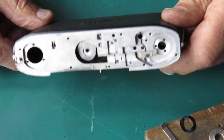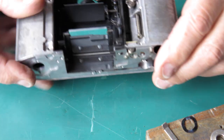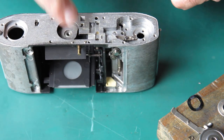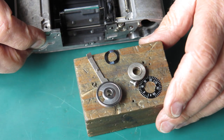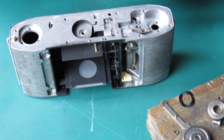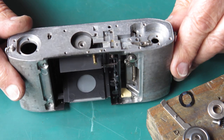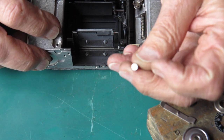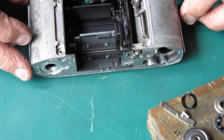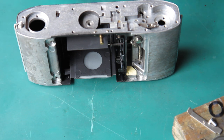As you can see I've been busy — I've been cleaning. This is all nice and clean now. The body is ready to be reassembled. I took the frame counter out — you didn't see me doing that. Basically it's all held in with a single screw from the center. Taking it apart is by no means as exciting as putting it back. That screw is always very, very tight, so you're going to want a very good fitting screwdriver and probably a pair of pliers to give you extra torque to get that screw loose. It's a chrome-plated screw — that head would be damaged if you cammed the screwdriver out, so just don't do that. Lots of downward pressure, use something to provide extra torque. Anyway, let's start putting some pieces back in here.